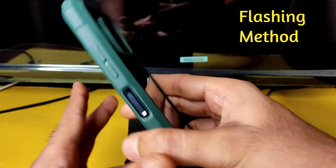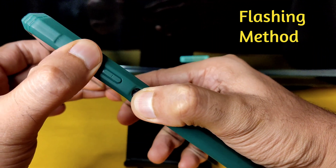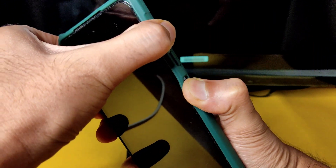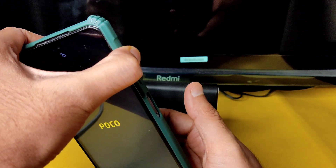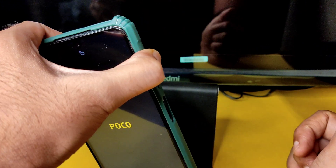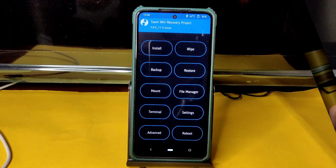There is no advanced restart button, so use the volume up button and power button to boot into recovery. Once the POCO logo appears, remove your fingers and continuously press the volume up button. You will receive haptic feedback, then you can remove the other button too.